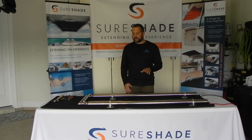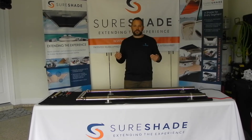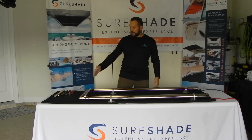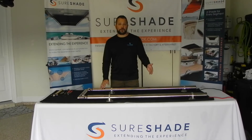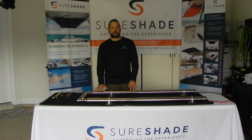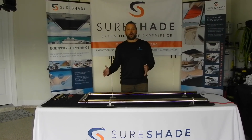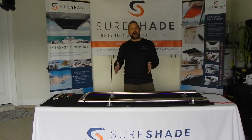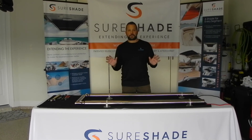In this video, what I'd like to address is: say your shade is three inches from touching your hardtop. Your closeout panel is three inches from touching, but it's fully retracted according to the measurements — one inch and two inch. What needs to happen at that point is the clamps need to be loosened and the whole assembly needs to be slid squarely forward or aft to achieve that closeout panel touching where it needs to touch.